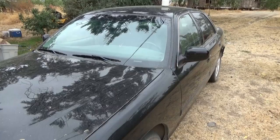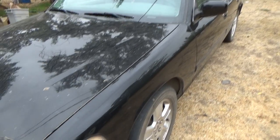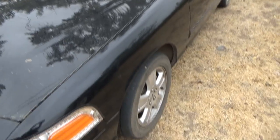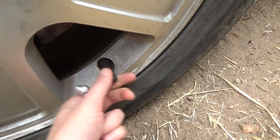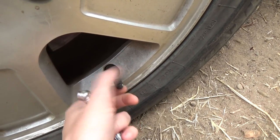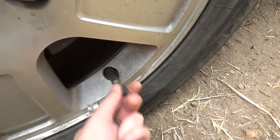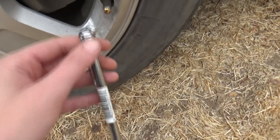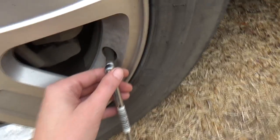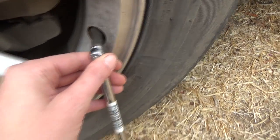I don't know why they don't just make it look like a fucking tire, but whatever. So let's go check our air pressure, shall we? First off, put your car on a very level surface, as level as you can get it. Then take your valve stem dust cover off, unscrew that sucker. Put your tire pressure gauge evenly on the valve and press.